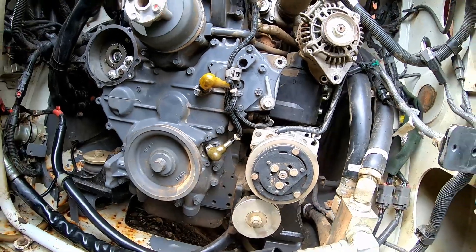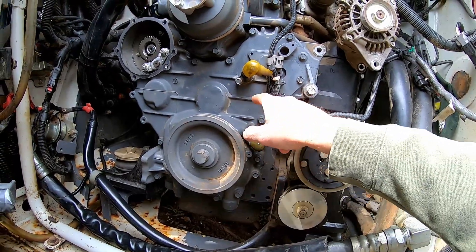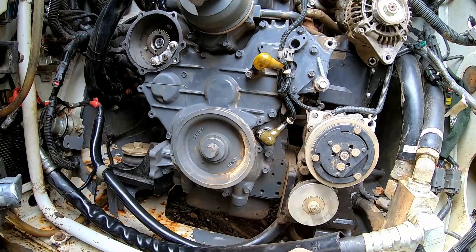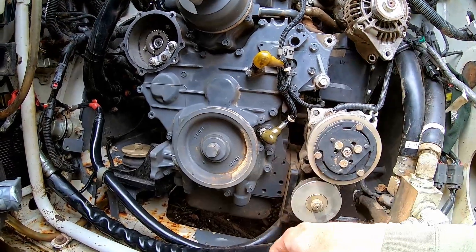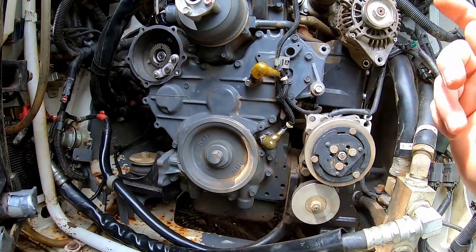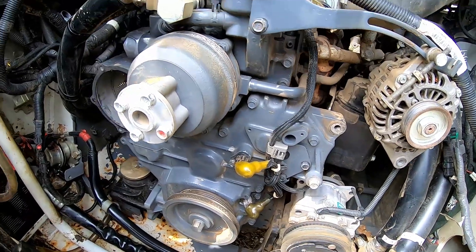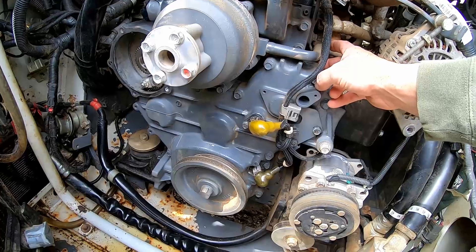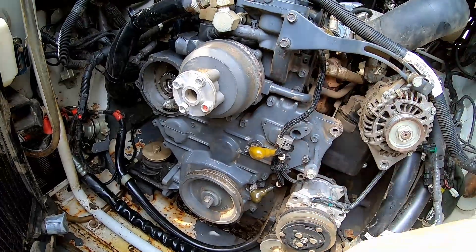I'm going to disconnect these two sensors for my own purposes. This one's marked NE, this one's marked G — I believe that's probably our cam sensor. This one down here could be a crank sensor, but I'm just guessing there. I'll undo the wiring, get this clip loose, zip tie it over, get the crank pulley off, remove all our bolts, and hopefully that cover comes off easy. There's no gasket in between here — it is sealant that I will have to reapply after cleaning the surfaces back up. There's a cover and then there's a plate; hopefully that thin plate that sandwiches between the block and the cover stays sealed at the back.